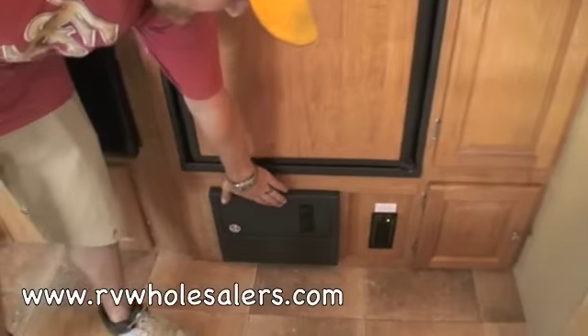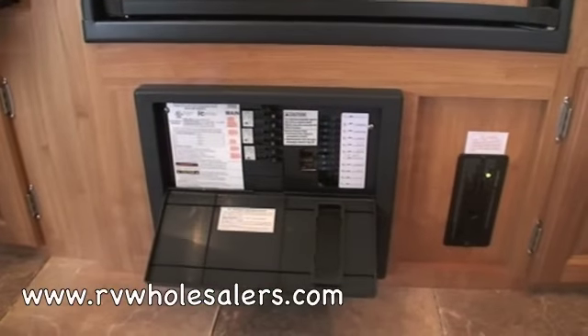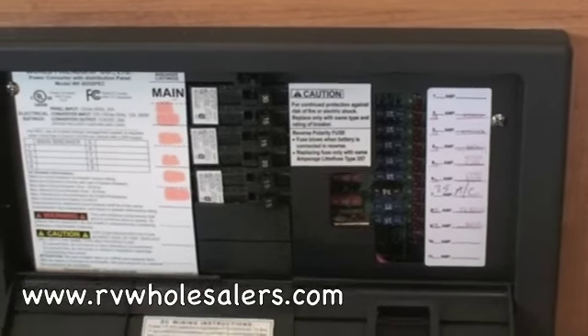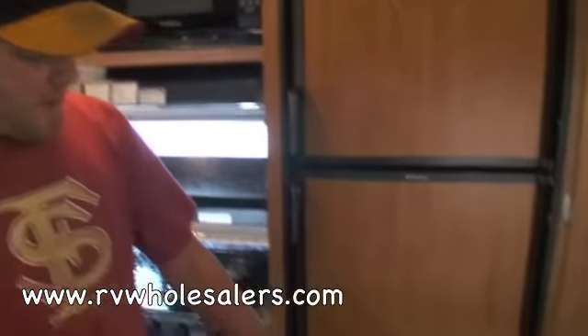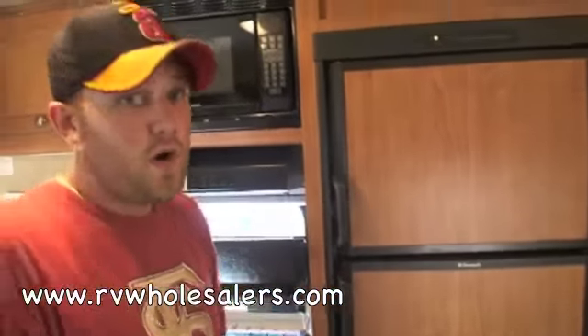Down below the refrigerator is your converter box. This is where your fuses and your breakers are — if you have any electrical issues, this is where you want to look. Anything that works off 110 electric has a breaker; anything that is 12-volt has a fuse, and they are all labeled so you know what they are. There is a small fan in the bottom that you may hear running — that just ensures that power is being generated and it's keeping itself cool. Right next to the converter box is an LP gas and carbon monoxide detector all in one. It is hardwired to the camper, so if the camper is stored for an extended period of time with the battery hooked up, this will drain power from the battery — which is why it's a good reason to disconnect the battery.